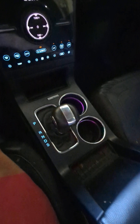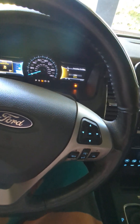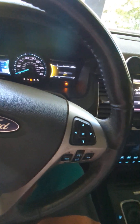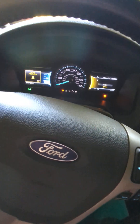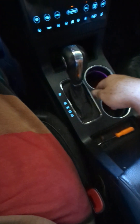Five minutes. One little tiny tool — that's all you need. So if your car is giving you weird alarms, like the door chimes are going off when you stop the car and put it in park and open the door, make sure that the park is actually showing yellow. If it is not, it's probably that little switch right underneath there. Good luck, guys.